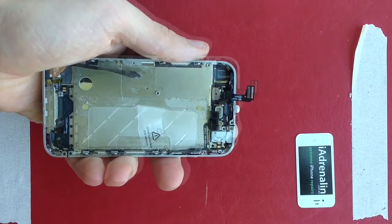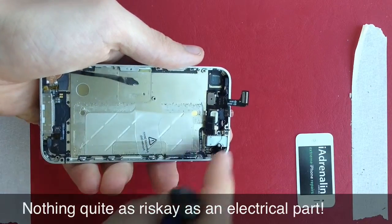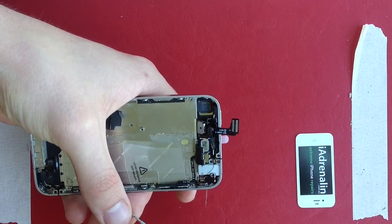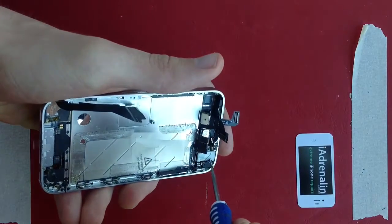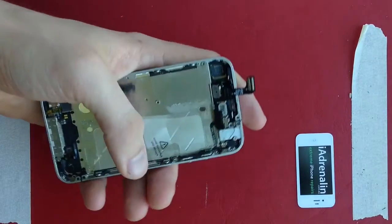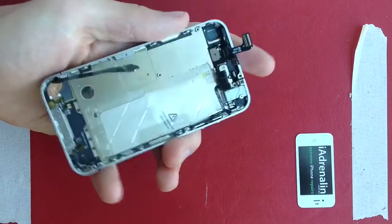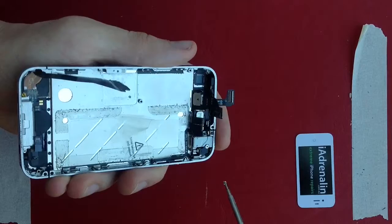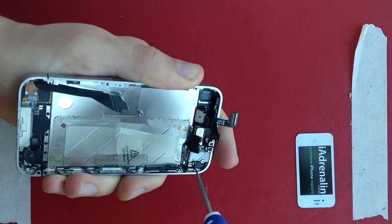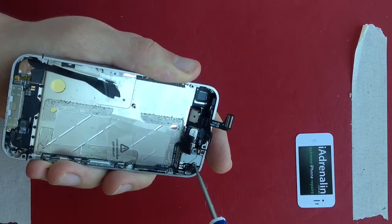Now I'm going to insert the vibrator again. I reassemble anti-clockwise as I disassemble clockwise, but this one is much easier to insert the large screw first, because trying to insert the small screw first is quite difficult on this particular part. You want to make sure the screws are quite tight as the vibrator physically moves, and that can cause problems if it's not tight enough. This is the threaded screw — just insert it again, be quite gentle, and don't go too hard or too fast.